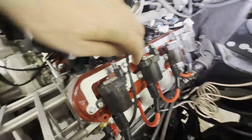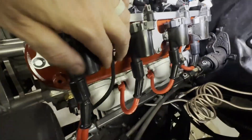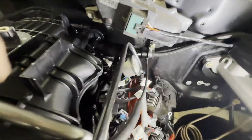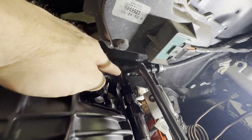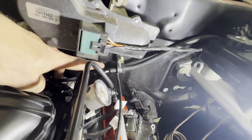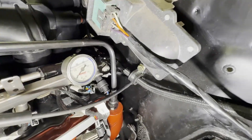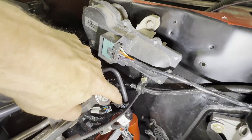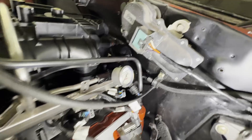I did have to relocate my wires out from under my intake back down to the outside of the fuel rail. My coolant temperature sensor — and as you can see back here, I've got my fuel pressure sensor. I used the fitting that came with it, plumbed it into my fuel rail, and I've got a 90 here that goes into the straight on my fuel line. I know that's a lot more leak points, but it turned out really well — it clears everything. Now I've got digital fuel pressure on my dash, plus I can look under the hood and see manual fuel pressure, and I'm loving the way this turned out.